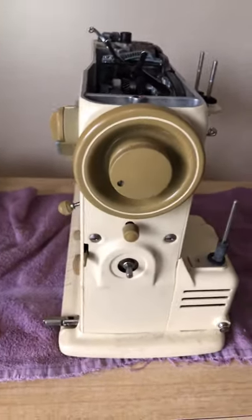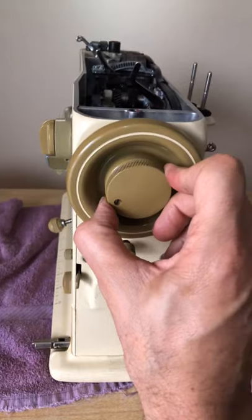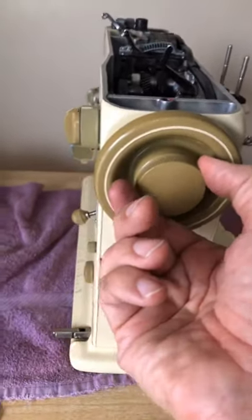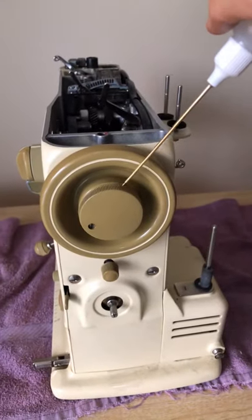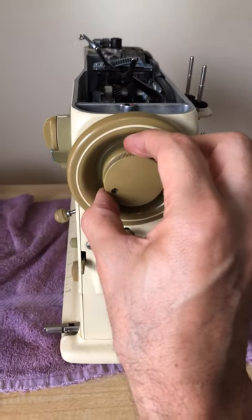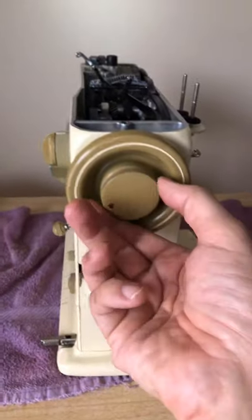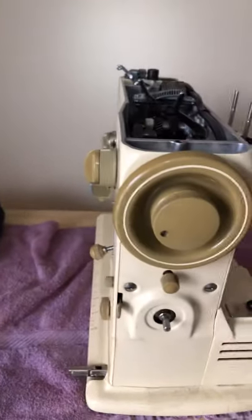This is always important — even if it's metal — but when you have plastic surrounding that steel, be extra careful. What happens if you get one that won't loosen? This will happen on a Necchi very often. You're going to have to be very careful about trying to get oil behind there. You'll also want to gently warm it — I don't use a heat gun, that's too hot. Use a low setting on a hair dryer, but you've got to watch it. Never get it super hot — you'll damage, crack, or melt the plastic. But sometimes just a little bit of warmth will loosen old gummed oil and help it release.